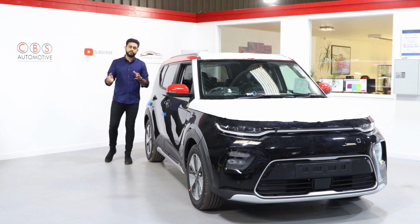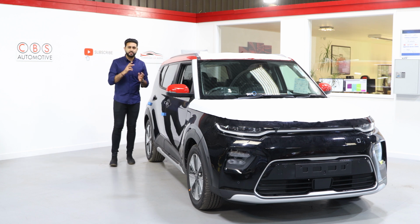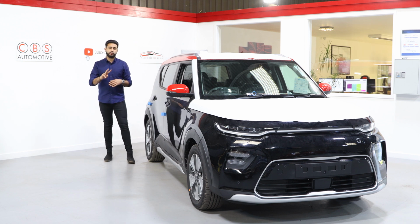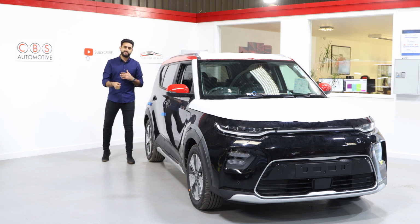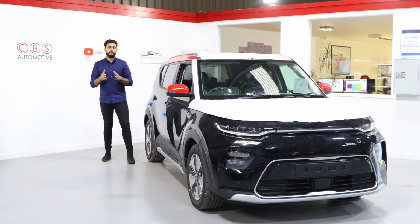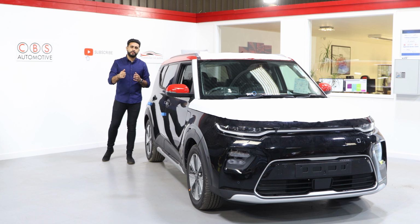Basically, bumper comes off, sensors go in, 17mm sensor, and it's an audible tone solution. In terms of all vehicles with parking sensors, we do 2 different solutions. One has a button. Basically, whenever you want to activate your parking sensors, you push a little button and it automatically turns them on, and then they turn off automatically as well. So that's the button solution.